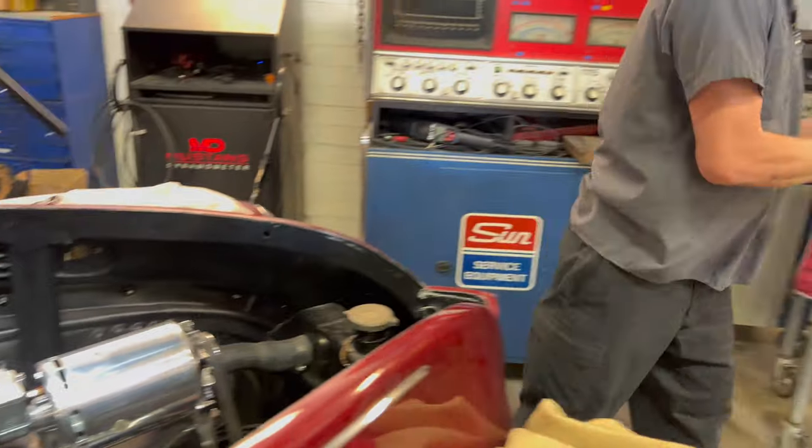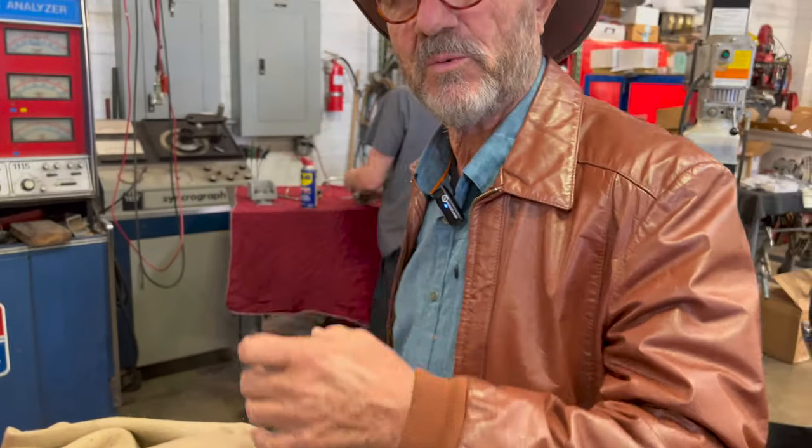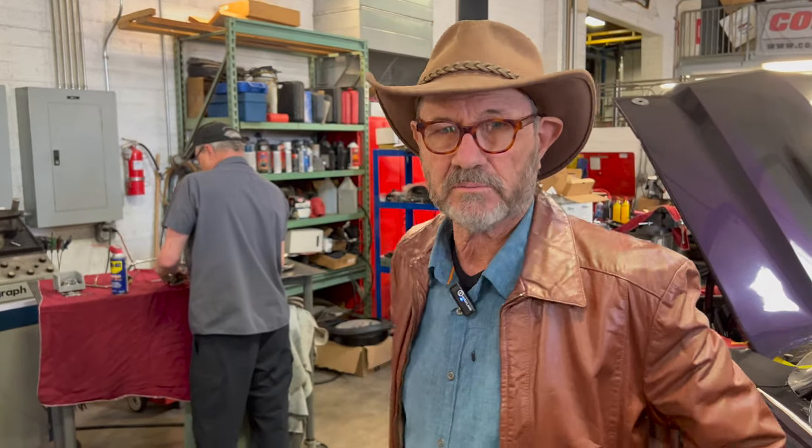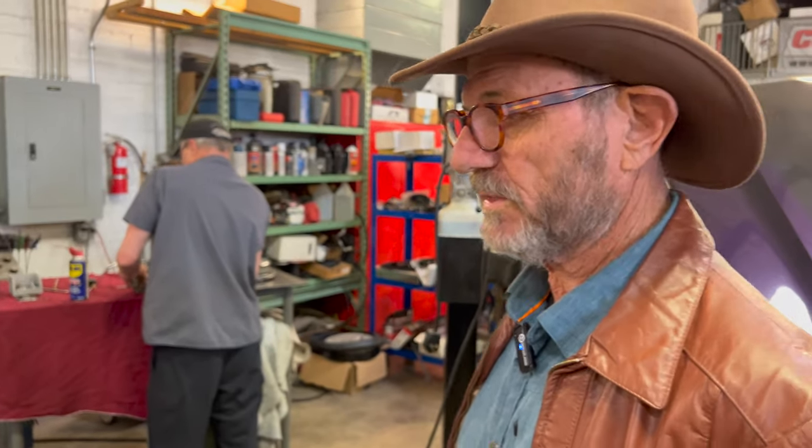So you see the friction? Yeah. That means it's grabbing the wall, creating a seal, so when it comes down, it can actually push the gas. Otherwise, the gas goes around it, and it doesn't push the gas. That's one of the things that was a symptom of what we were seeing happening, but we couldn't figure out why.